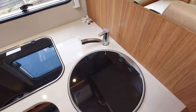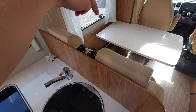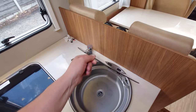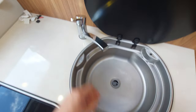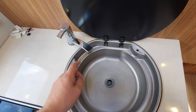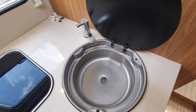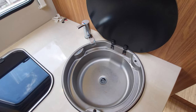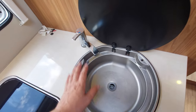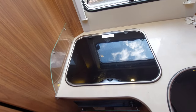When you first fill up your water tank, it's very important to purge all the air out of the pipework. Switch the pump on and pump water through the motorhome until you get a pure flow from your tap. Open the tap on the hot side first, because that fills up the boiler. There's no point switching the boiler on until you've purged all the air out — if you switch the boiler on without doing that step you're basically heating thin air, and you risk overheating the boiler. Wait until you get a pure flow of water on the hot side before switching the boiler on.